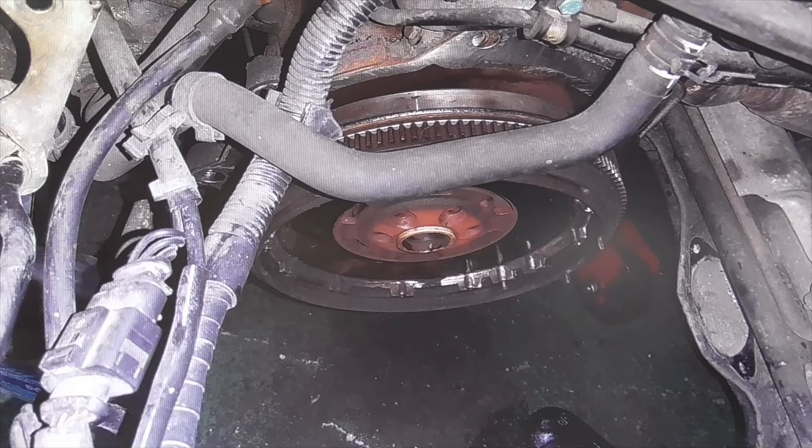For cars with less displacement or normal driving — even vans — it is commonly done. Vans with around 100 or 105 horsepower, many TDI 1.9s, are often converted to monomass. Some dual mass flywheels only last 50 or 60 thousand kilometers, which becomes a financial ruin. The monomass lasts a little less, yes, because it does not absorb as much — the impact when engaging and disengaging the clutch is stronger — but in the long term it is profitable for them.